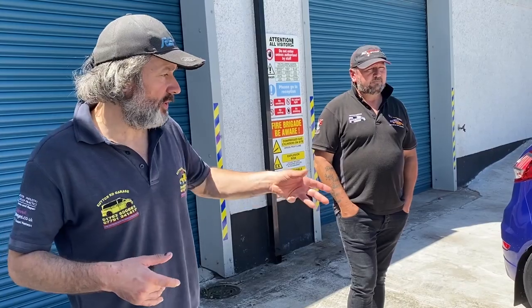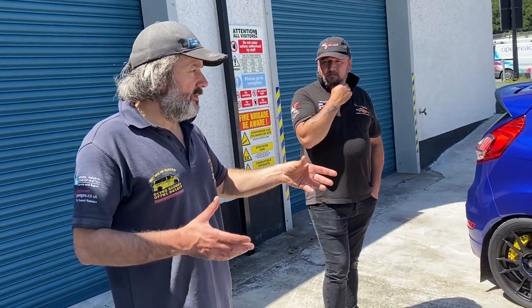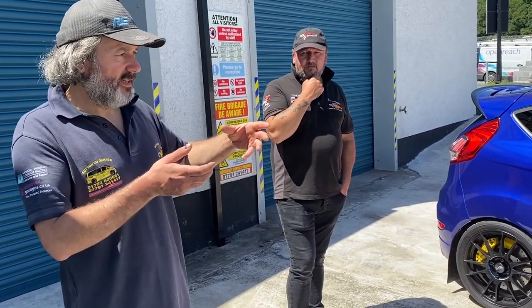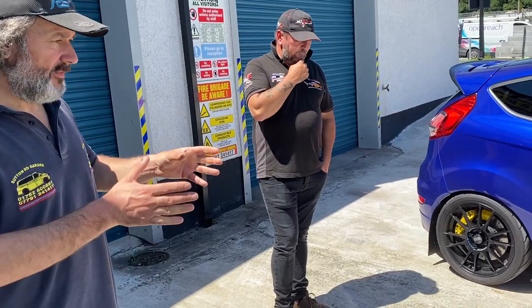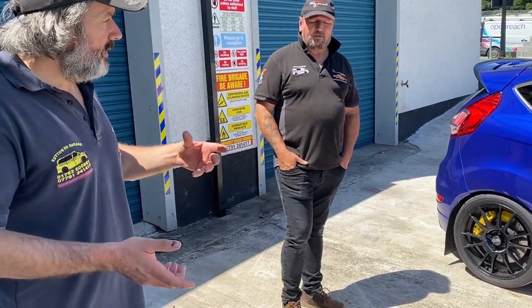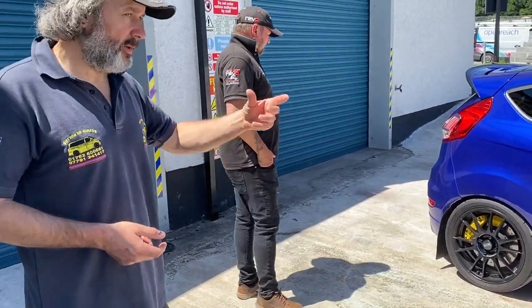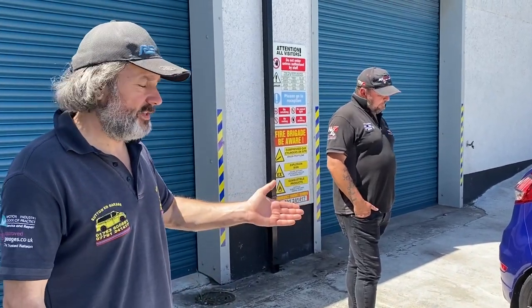I don't know that, but all I know is that it took a lot of working out. So we've got the maths right on this. It was to retain the OE stock electronics, the ESP, the ABS braking, with the brakes that we fitted. That's really important. Now, it's not the end of the world if you have to put a brake bias valve in, because then you could pull braking from the front and put it to the rear and all that sort of stuff.